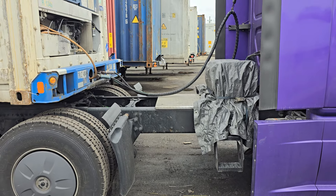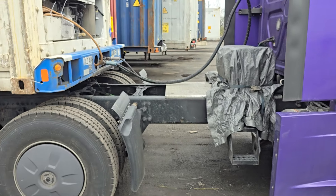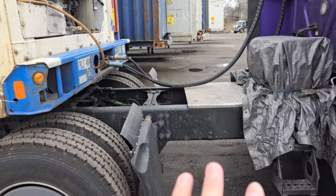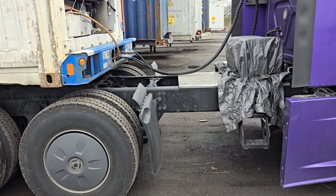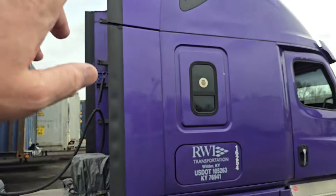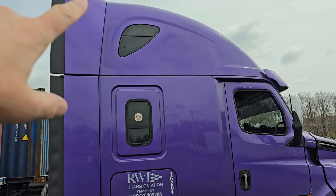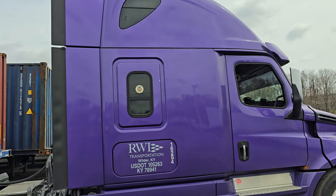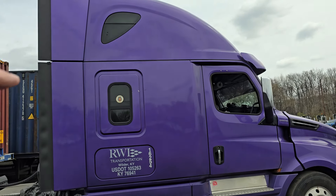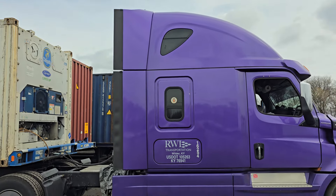The unit is 18,000 pounds — that's my mistake. My second mistake is the long frame. I love to drive smooth so I ordered a long frame, but this is additional weight — no good. The frame for containers must be as short as possible. This is a 255-inch frame base; you probably need 234 or 240 inches — you'll be fine.